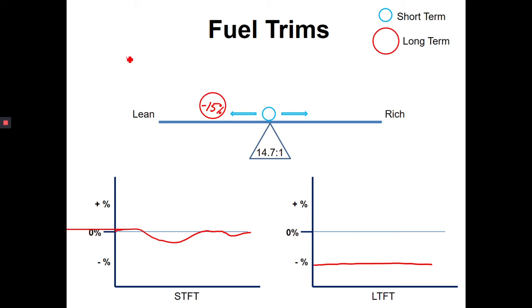It's very common to look at your fuel trims for diagnosis. If you have a vacuum leak and there's an actual physical vacuum leak, your short-term fuel trim may read something like positive 4%, and then your long-term fuel trim is going to read maybe positive 18%. That means it's adding 18% more fuel for the long-term. The short-term is closer to zero — maybe negative 4% — making small corrections for normal driving. The long-term stays much higher because it's correcting for a vacuum leak. If it was a fuel leak, then maybe it would be negative 18% and the short-term will be cycling positive and negative close to zero.